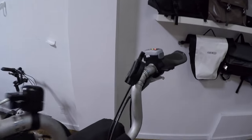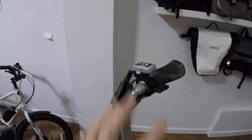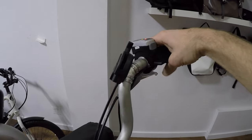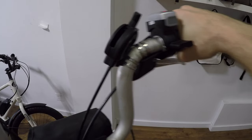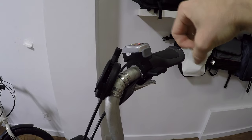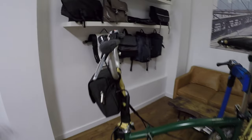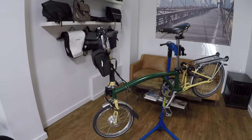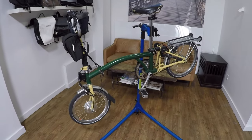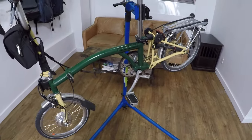Some of the trade-offs with a design like this: you can accidentally bump it if you're lifting it or parking it at the bike rack, and it's kind of cheaper. It might be a little more distracting if you're riding and compromising your grip in order to press that throttle, versus keeping your eyes on the road and focusing on pedaling. Some other throttle-powered electric bikes have a half-grip twist like a motorcycle, and that's another trade-off where, if you're riding over bumpy terrain or on a mountain trail, it's easier to accidentally activate that more so than the pedaling situation.